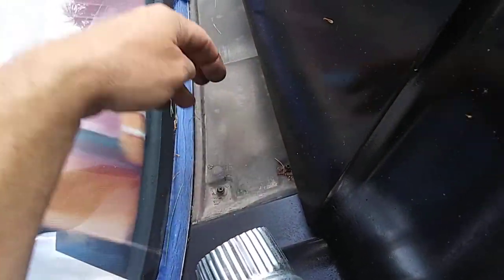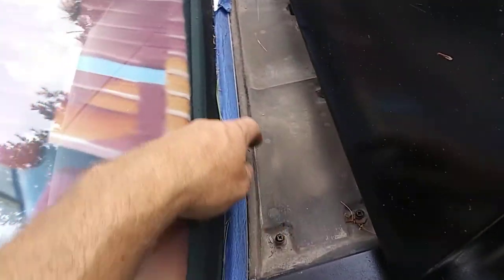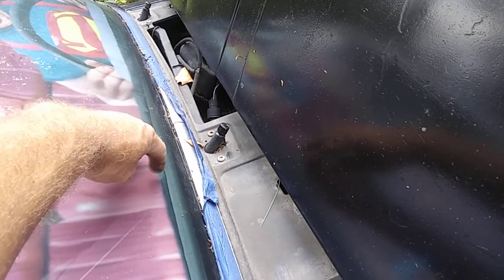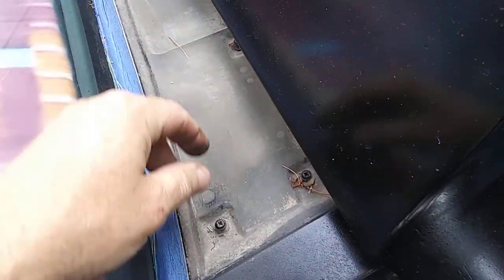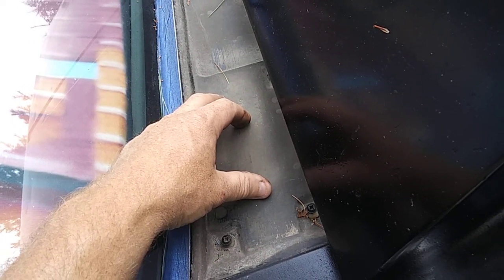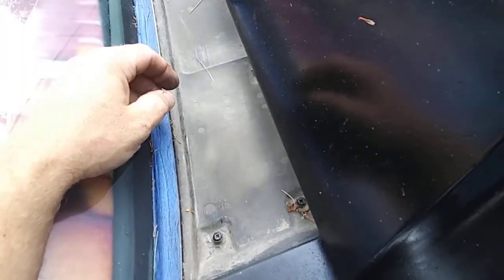With this panel here, this piping is going to be going down inside the cavity underneath this panel. I still have to figure out how I want to modify this, because the plate goes clear across here and covers up where the fresh air comes in for your AC unit slash heater. Over here it comes in, goes underneath, and I believe right about here there's a rectangular hole where the fresh air comes down in. When I shone the light in there, I noticed that from the factory they don't put a patch of screen over it — like a screen door — to keep bugs and debris from getting sucked down into your heater box.